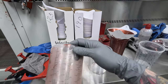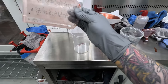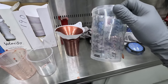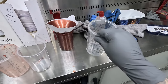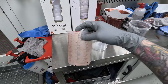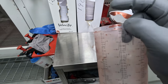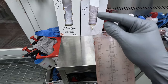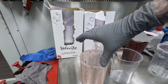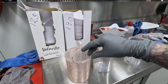One of the downsides of the 3M pots is that you only get a new hard case once per box, whereas with the SATA RPS you get a new pot every time — it's not a liner bag type system. I literally just saw this as I picked one up — have a look at that. That is the kind of thing that can fall into your paint job if you're not careful. I always try to give that rim a wipe down before I put any bags in there, just to keep it clean.